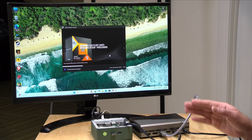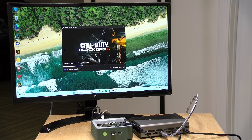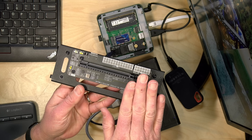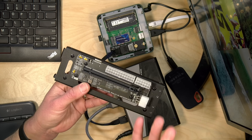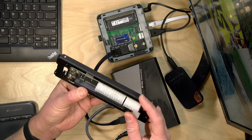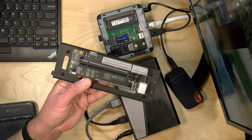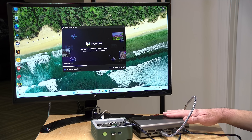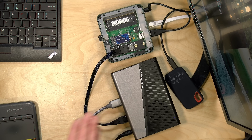You should know that you could probably buy three or four of these mini PCs for what one of these GPUs costs, so this is not the most practical solution. Beyond external GPUs, Oculink also lets you attach a full PCI Express slot for any card — a 10-gig network adapter, a video capture card, and more. The challenge is that you need an external power supply for the card. This GPU solution is nicer because it's self-contained with its own power supply.